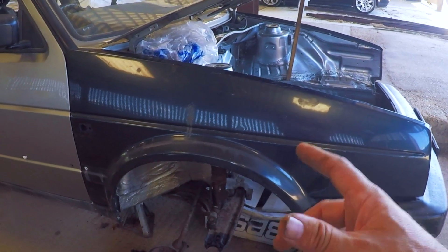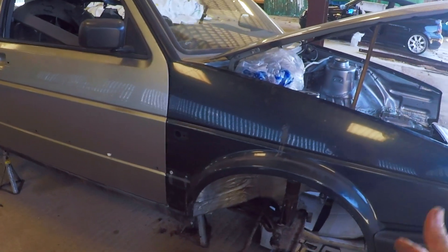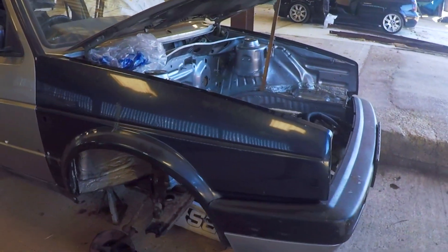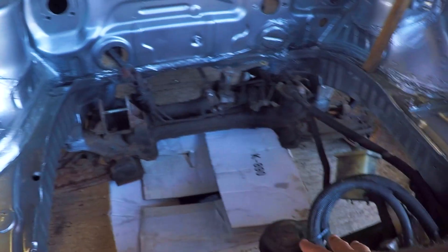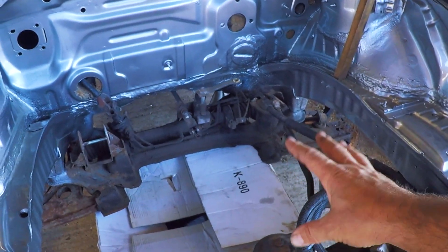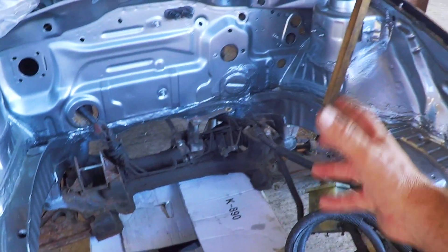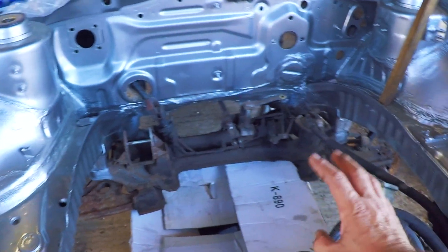We're going to go 312mm brakes, so with the ABS and the 312s on this weight of car it's more than adequate to stop it, especially with a good-size tyre. For the front crossmember front mount, we'll probably go with a solid mount for cost, or I think I may have a Vibratec front engine mount lying around from an old project — so potentially we'll go with that.